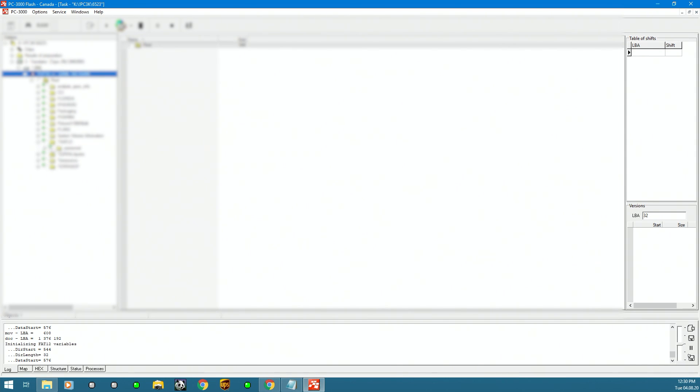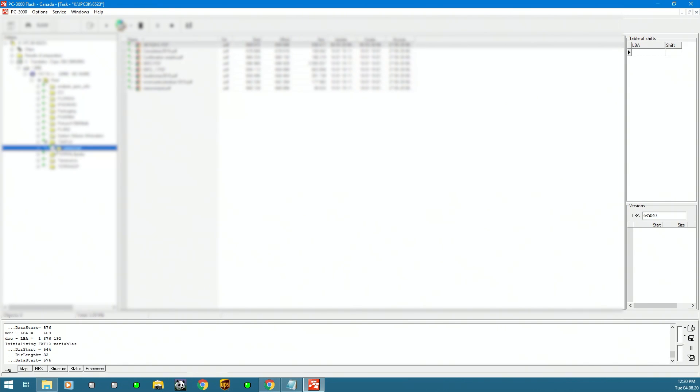This case is considered solved — it was pretty straightforward and easy with this powerful tool. Flash drives like this sometimes come in with epoxy over the controller, sometimes over the NAND, sometimes over both. I can't recall if I've personally seen it, but I've seen a picture online where both sides had epoxy. In our case we were lucky the controller was available online and open source.